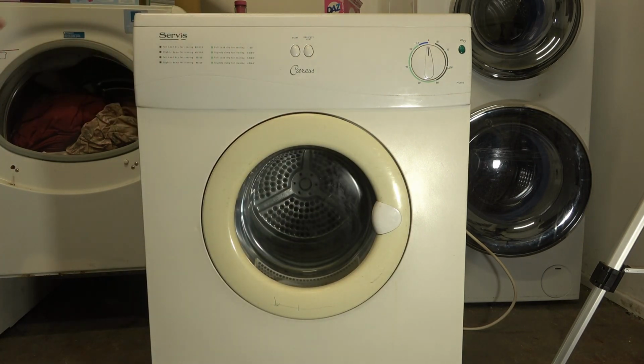However, what I do like is how they put the assembly of the heater. It's got a little panel by itself, so if you want to go change the heater, it's so simple. It's 4 screws and it's out and it's away, and you put another one in and away you go. And you've got access to also the thermostats there too. So serviceability of these is pretty good as well.